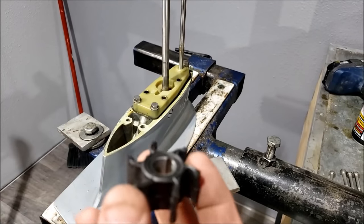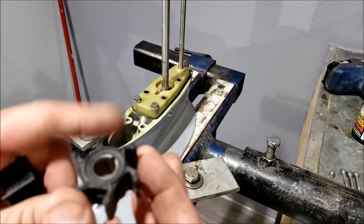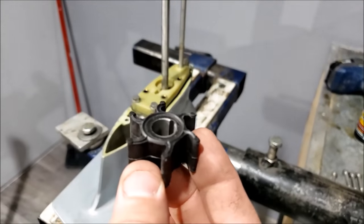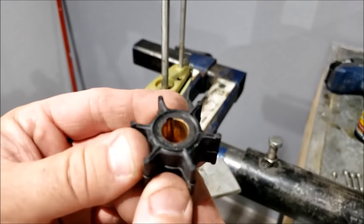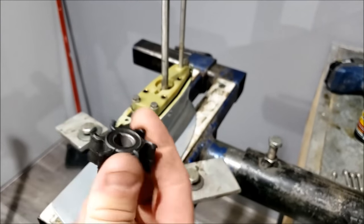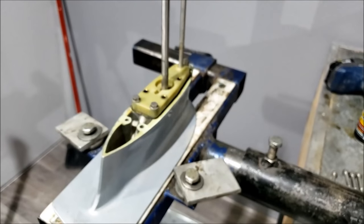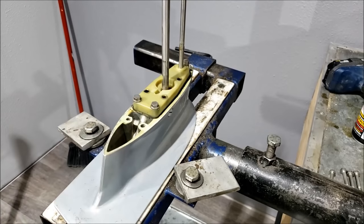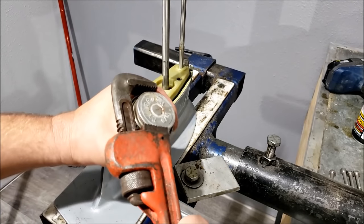The next notable thing is the original impeller here has a steel inner, whereas the new one is brass. So if rust is a concern, the original is not so good. Last summer I bought a new bottle of gasket sealing compound, so that's good — glad I had that on hand. Going to go ahead and open that up.